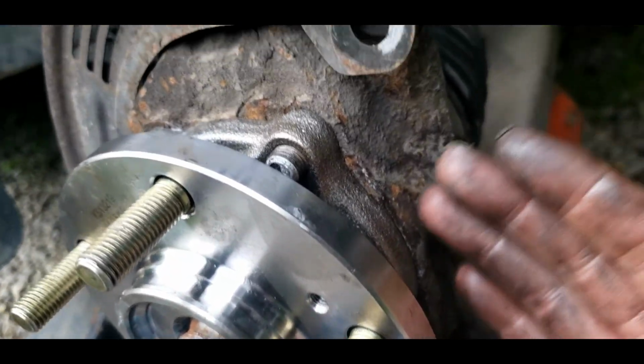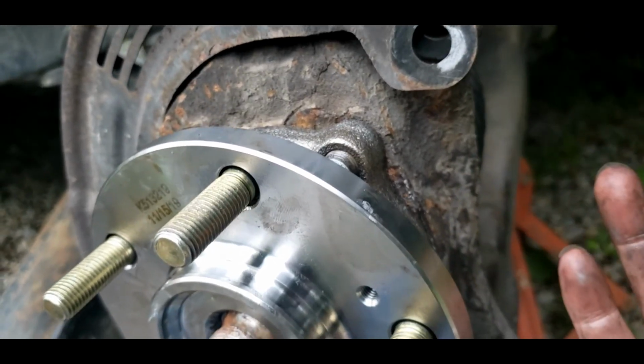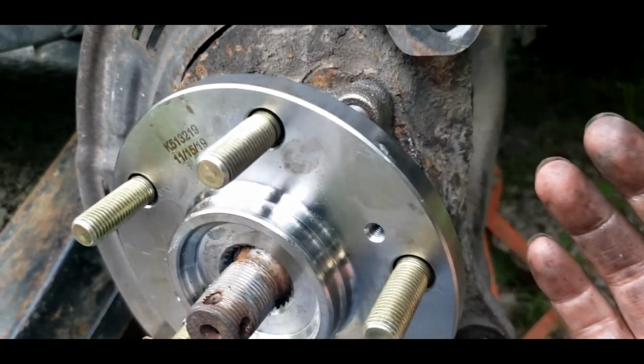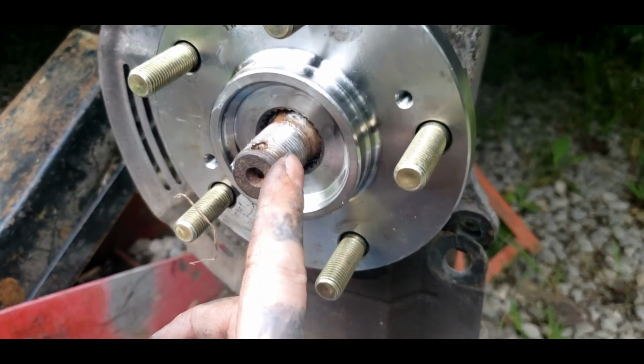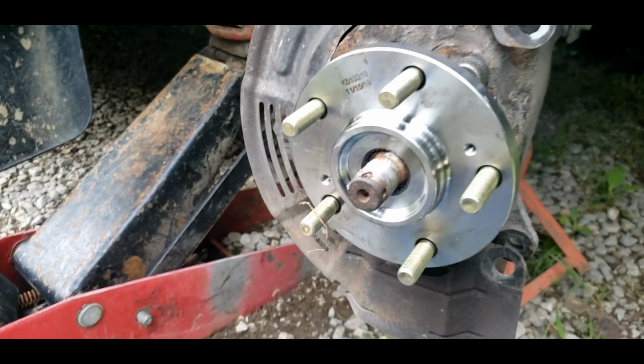So once you got your new bolts torqued down, you can get them super tight, or you can torque them to specs. It's up to you. I recommend torque to specs, even though I didn't listen, but I am going to torque the axle nut to spec, because that's the most important part. These need to be super tight though, but not tight enough you strip the housing.